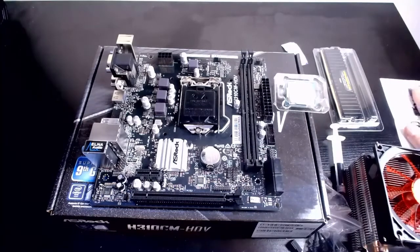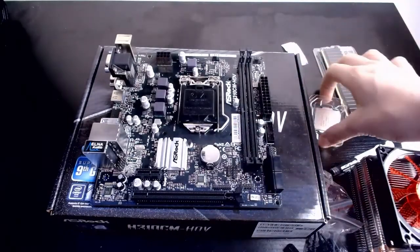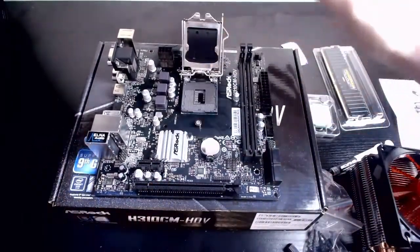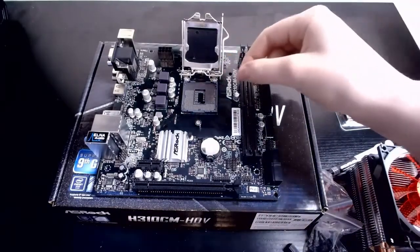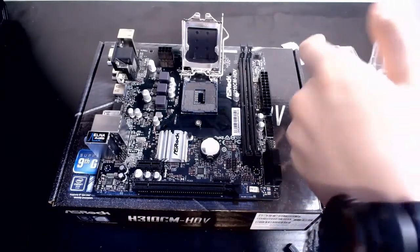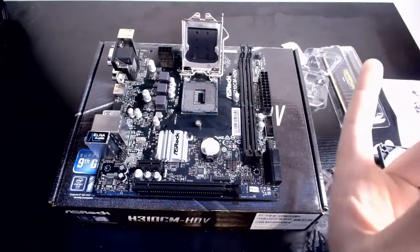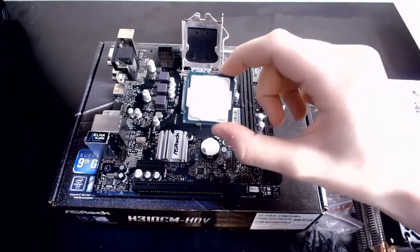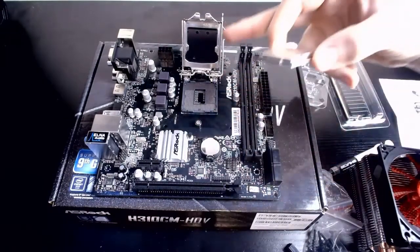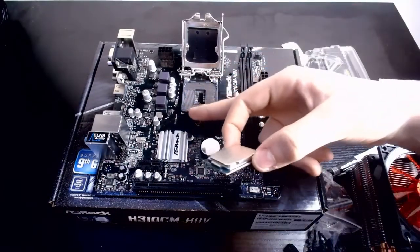Oh well. Okay, so to start with the motherboard, we're going to knock over the CPU there, that's fine. Open this retention arm, pull that back, very nice, showing all the pins on the motherboard. Do not touch the pins. If you bend them, that is a very bad idea. So, being extra careful with the CPU, open it up, very nice. These two ridges here, take it out, and you'll see on the CPU there is a tiny arrow right there. Tiny incy wincy arrow. And on all, well, all to most motherboards, there's a tiny arrow right down there. You can't really see it. There's a tiny little arrow down there.